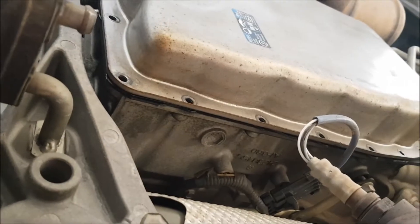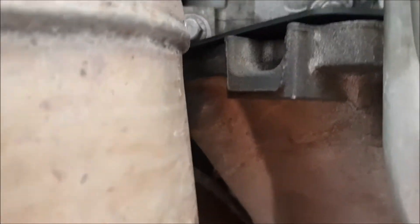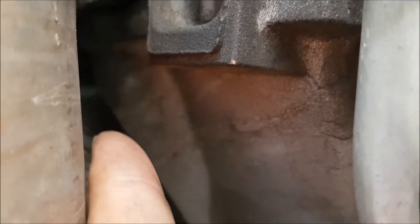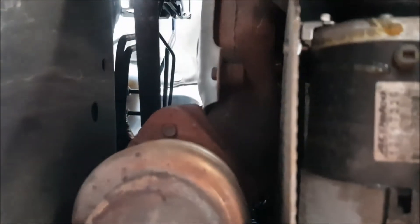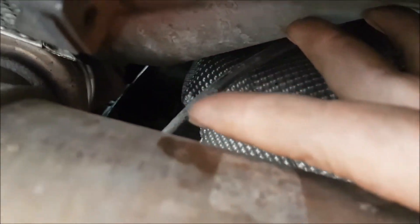I've been having a good look around underneath here, and this exhaust part is really in the road — particularly these two front catalytic converters. It's a big hot-dog looking thing there. If you look straight up the sides at the bell housing, there's not enough room to drop the bell housing out in between these two cats. So I'm going to have to undo them. They've got two bolts on each, facing from the top, so I'm going to undo those from the top.